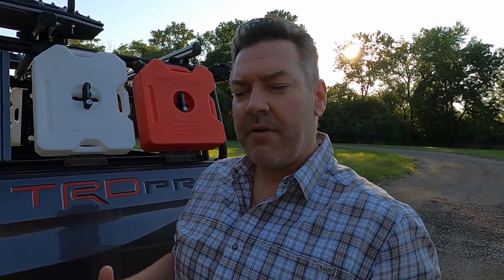The rear, however, on the 2016s, that was a problem. It was a little saggy. And the reason it was saggy was because they built the truck to be more of a pre-runner, and it was sitting a little bit too low for my tastes. So there was a company by the name of Coach Builder, and they make a 3-inch shackle, which gives you about 1.5 inches, or 1.375. That pounds out. Put in a new shackle that raises it back up.